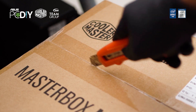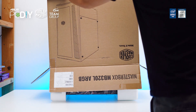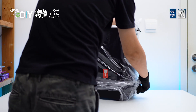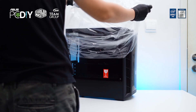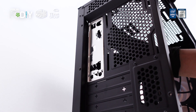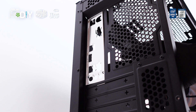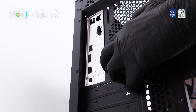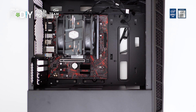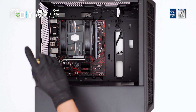Now it's time to unbox and prep the case. Today's case is a Cooler Master MasterBox MB320L ARGB, which is a Micro ATX case, and our ASUS motherboard will fit just fine. Always remember to purchase the correct case that will fit your motherboard. Now remove the tempered glass and the side panel before we move on. Check if the rear I/O cover is built-in or separate, then align and install it at the back of the case by pressing the edges until you hear several clicks. Lay the case flat on your desk, lower the motherboard until the rear I/Os are aligned with the cover and all screw holes are aligned with the pre-installed standoffs. Secure all 6 screws and you are done.